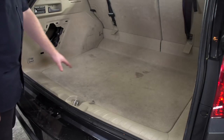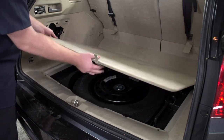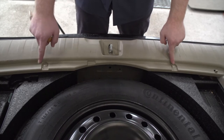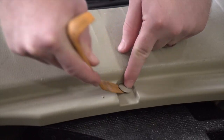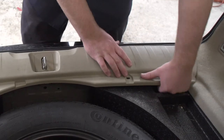To bring our wiring harness through our cargo area to that point, we're going to start by removing our floor covering. Next we'll remove the rear threshold. It's held in by two pins, and we'll remove it using a trim panel removal tool by just pulling up on it.